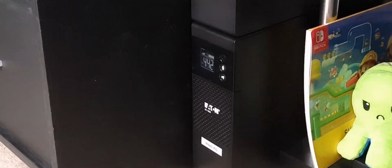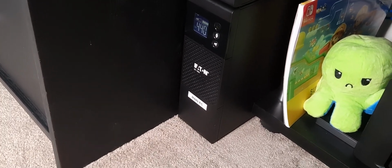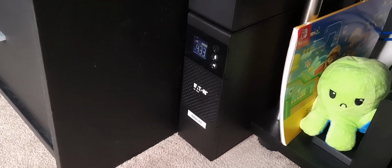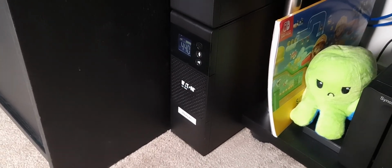not always avoidable. So there we go, those UPS batteries have been replaced, and this is basically a refurbished unit at this point, and you could go to resell it, you could continue to use it. If you had a really old enterprise UPS and it still worked aside from on battery, this is the sort of thing you could do, and you could save a lot of money on a new UPS, just changing out the batteries and going off that.